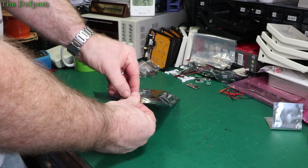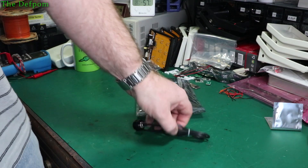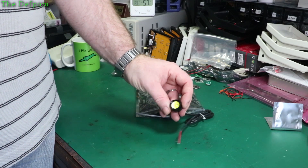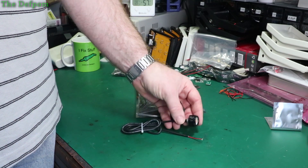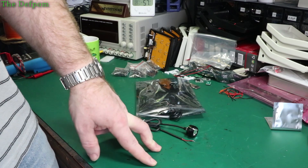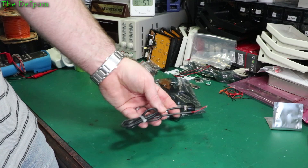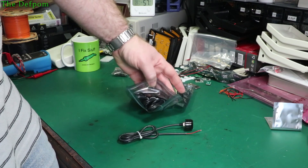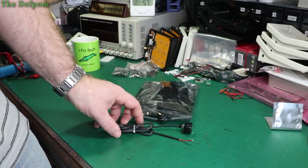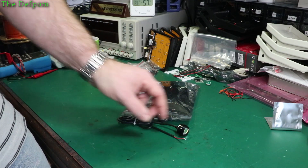These are some replacement LED lights. I've got these on the front of a couple of my vehicles and on the motorhome as daytime running lights. They've got a couple of one-inch corners on the bottom — they're one-watt LEDs and they actually work quite well. However, I've been having problems with one in particular on the motorhome failing. It failed last year, failed again this year. I actually used all my spares — I always get spares — but thankfully I can still get them, so I bought a bunch more. On my car they're still working fine. The motorhome has a 24-volt system and I've got a buck converter in there to drop it down to a safer voltage for these things. Maybe it needs readjusting.